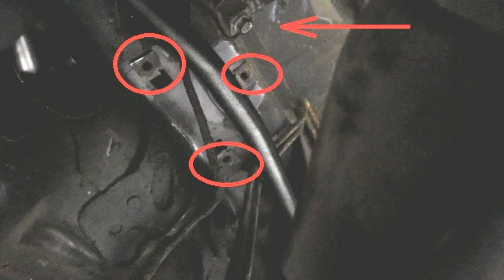Once you install the upper torque box section, you can then modify by cutting or grinding on the original factory brackets to reinstall them back into the car. I highly recommend either removing or loosening your tailpipes and catback exhaust. It makes it so much easier to be able to maneuver inside the upper torque boxes.